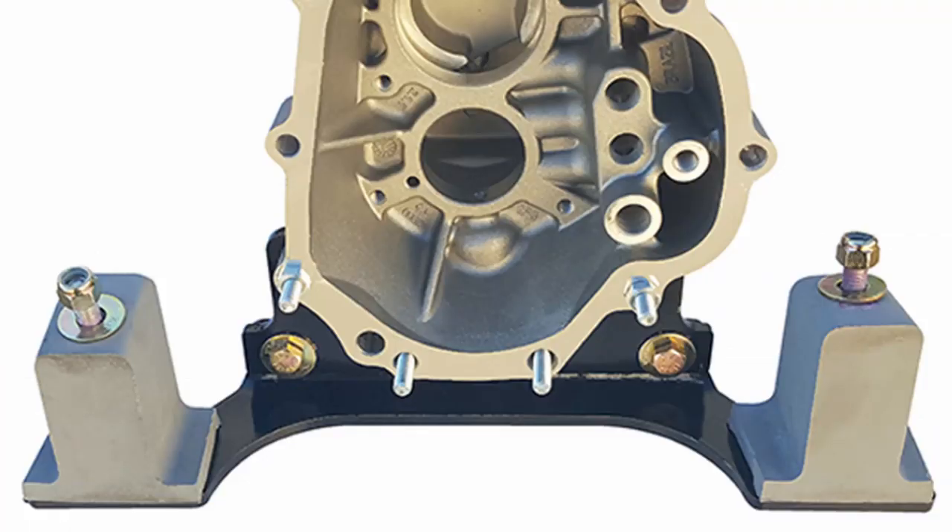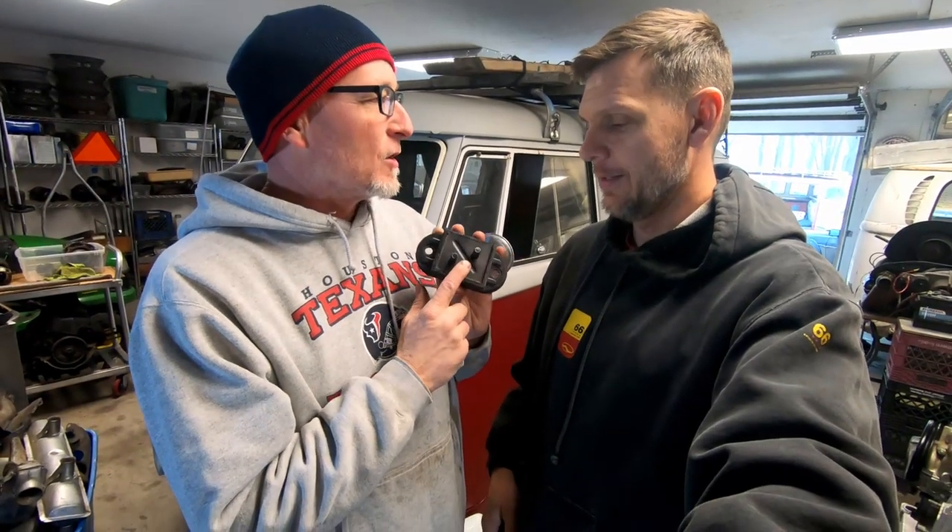Most people call it a mid mount. And why would you want a mid mount? Well, what happens on a bus is a lot of pressure gets put on this little mount right here, and when you have to change this in your bus it becomes a major project. So what the mid mount, or stabilizer, does is keeps this thing from shearing. This is your front transmission mount on a split bus, so that's what we're gonna work on today.